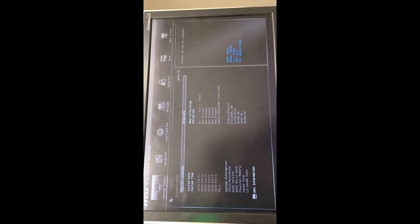So what happened was, I had to clear the CMOS again because the bad hard drive wouldn't load Windows, and I changed the CMOS for the boot, it just didn't work. So I had to not clear the BIOS, just the CMOS, and basically start fresh, put everything back together. Had to reboot a few times, but it just gave me the option to go back to default. So I went back to that. I got my screen back.